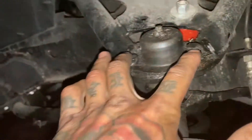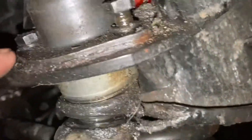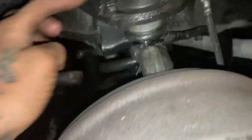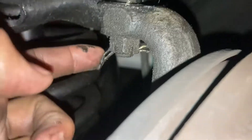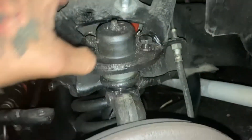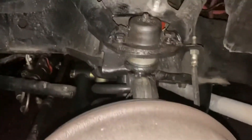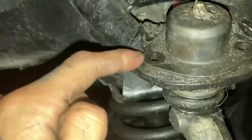I'm gonna do the other side now. All I have to do is take these out — I don't need a ball joint remover. This is a 13. Take those out, take this nut off — I think that's a 19 — take that out, take this nut off, and this will pop up, this will go down, this just comes right out. No tool needed. The nuts are out.